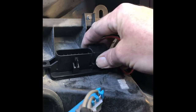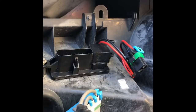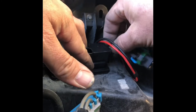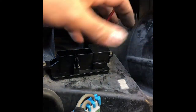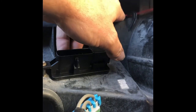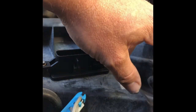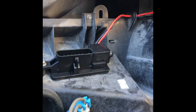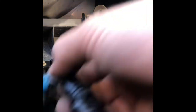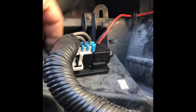Okay, it just goes in like that — only fits one way. I noticed with this that the original wire was supposed to go up here, come through here, and then clip in. It's super tight but it can make it — and that's supposed to have shrink wrap over top of it so it can't rub on there. That's in place. This is in place. Let's go ahead and see if that blower motor works.